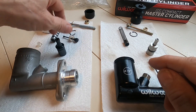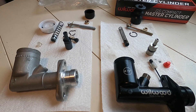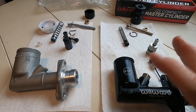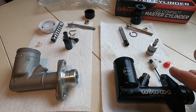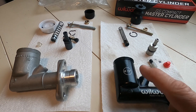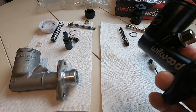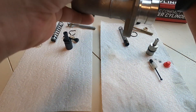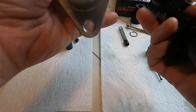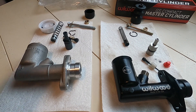That's why I went looking for better quality, so I took the Wilwood apart just to compare it to the other one and see the differences. I'm going to go with the Wilwood on the brake master cylinder, and I've got a 5/8 coming for the clutch master cylinder. My main concern was that all the mounting dimensions would be the same and that they would mount in my brackets — and physically they have all the same dimensions, just different castings.